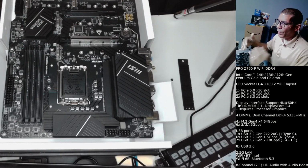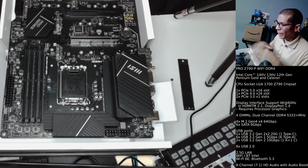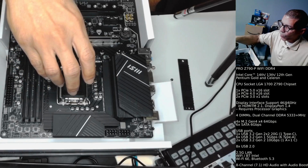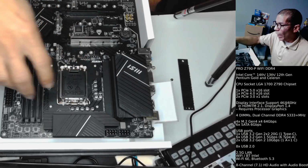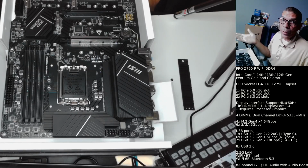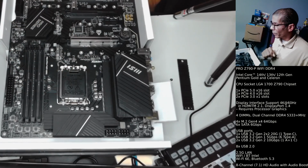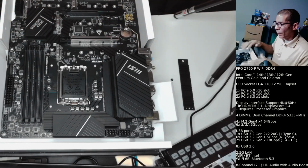With the overall architecture of motherboards, everything has to communicate, and obviously towards the processor. So you're going to have things that have higher priorities than others, and in this case the memory obviously has a higher priority and a higher bandwidth between the CPU and the memory. So these two items here will have higher priority and higher communication speeds. And that's inside the electronics, and all those little lines pretty much serve as highways, if you will, inside the motherboard and the different layers of the motherboard.